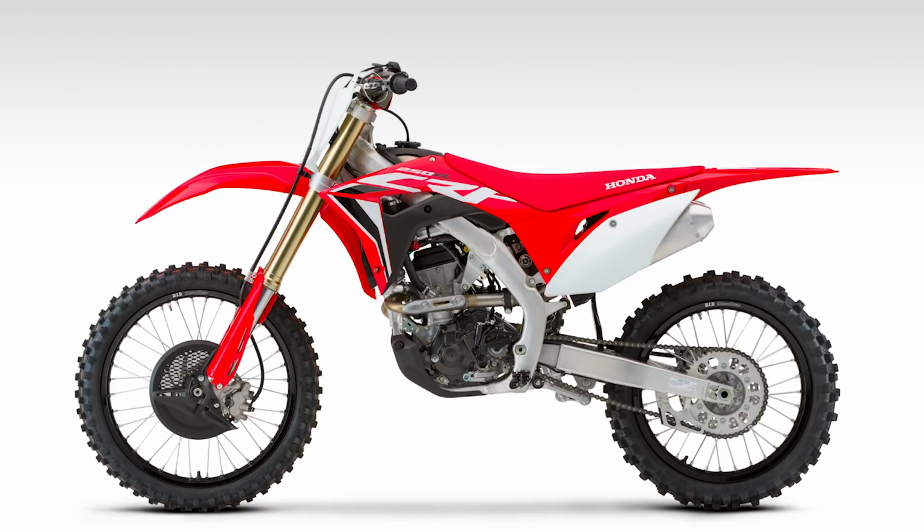It's good to see them going back a little bit more towards top-end power because last year they made some tweaks to mapping, head pipe, and throttle body size to try to improve the mid-range. And while they did make it a little more responsive in the mid-range last year, they almost, in my opinion, started to get away from the top-end power the year before. They didn't really make an overall improvement last year. I felt like they just moved the power around a little bit and made it feel a little more responsive. But in this case, they've got a few changes in here where they're definitely trying to increase the actual output. The cam profile from 6,000 to 10,000 RPMs, first one.